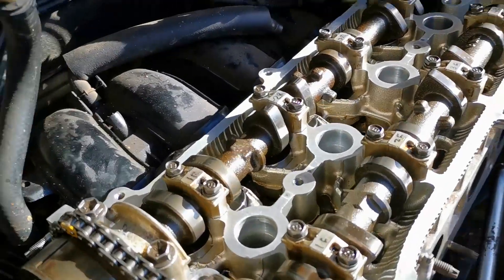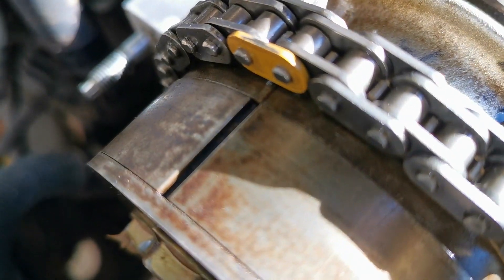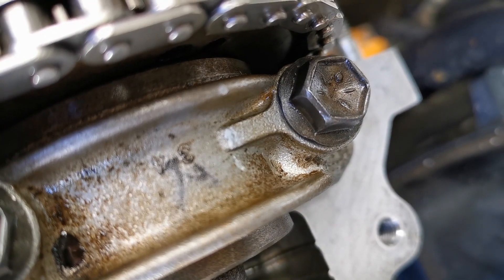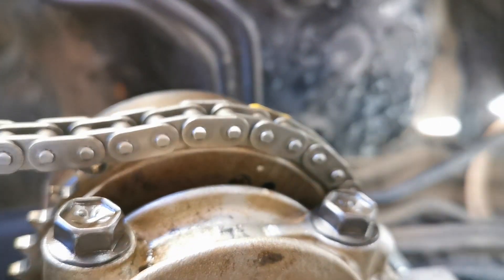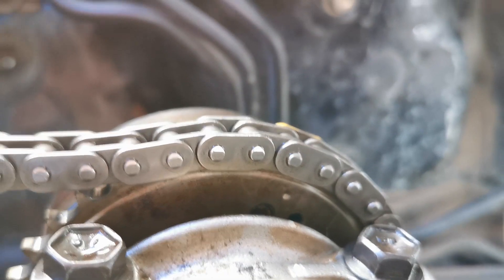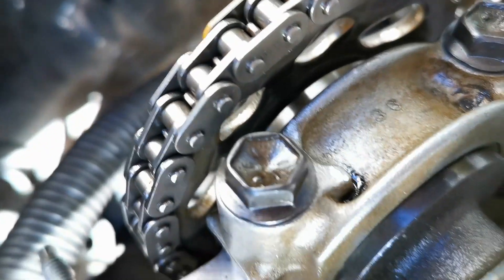Come up to the top side — you see this line here, and then if you come to the back onto the cam cap, you see that little arrow that I have marked in white. At the back there's another little dot that's going to line up to those, and the chain has got to sit on that dot as well. Over here, same thing — there's a little white arrow right there.